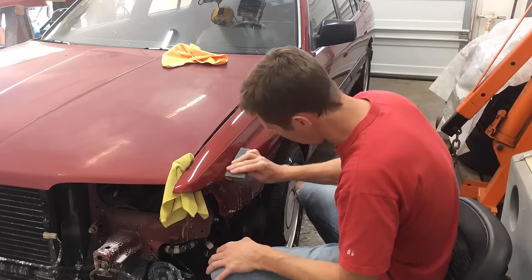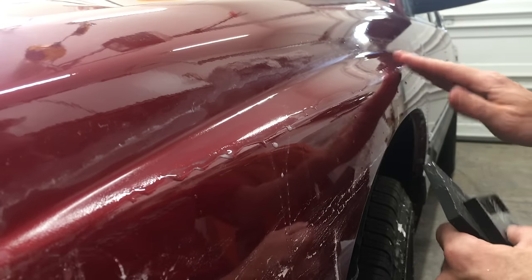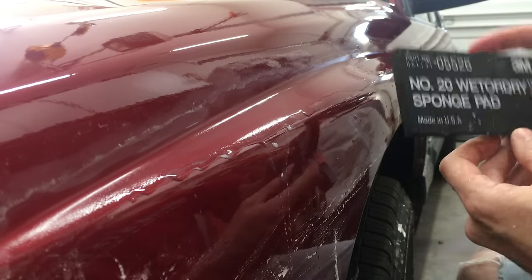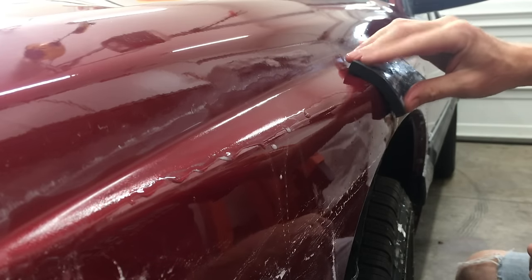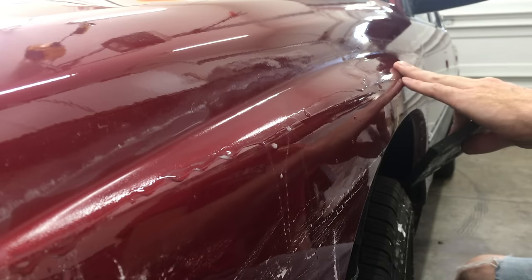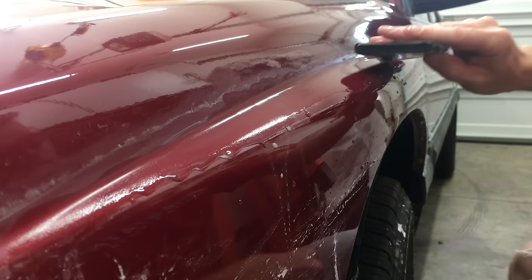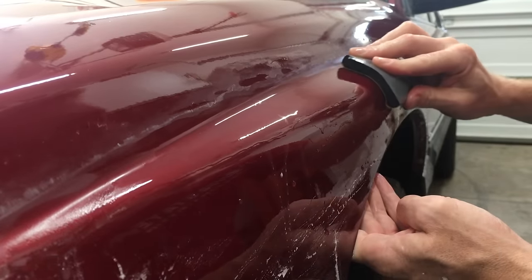I got to work on the fender with the 1500 grit. I just sanded the flat surface with the 1500 and the stiffer block, and over here too where it's flat. Now I need to switch to a more flexible sponge for all these rounded edges and contours. I have this 3M number 20 sponge — you can see it forms to just about any curved surface, and that will help me sand surfaces like this fender. I'll have a link to the sponge in the description. I'm also wrapping this with a piece of used paper instead of brand new — if I'm sanding a raised edge, which is easy to sand through with too much pressure, a used piece of sandpaper will be less abrasive and give me more room for error.